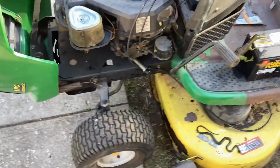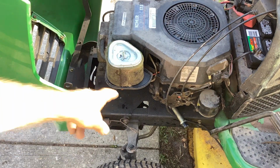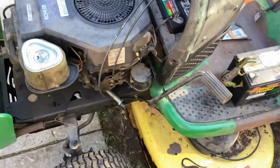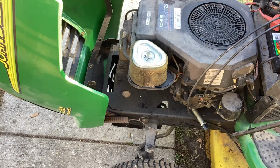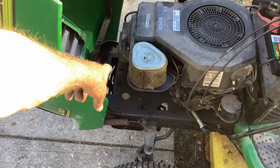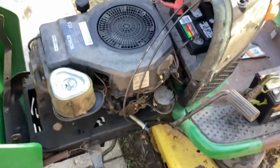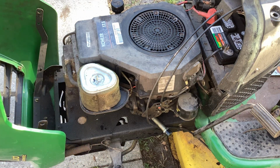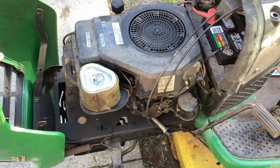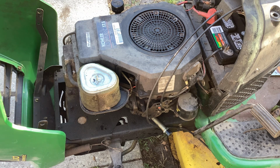Let me set you up and I'll let you listen to this. It kind of smokes. I had drained quite a bit of oil off of this after the first video. I just let it drip into a container to bring it down. I don't know if we have a leaky valve cover, but everything that dripped down onto the muffler has been burning off. With it running, I moved it forward and back, but I could hear that clatter on that pulley that's melted. I didn't engage the blade. I don't want that string getting any more wrapped up on that one spindle.